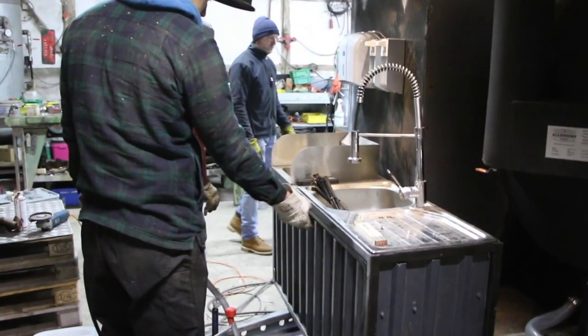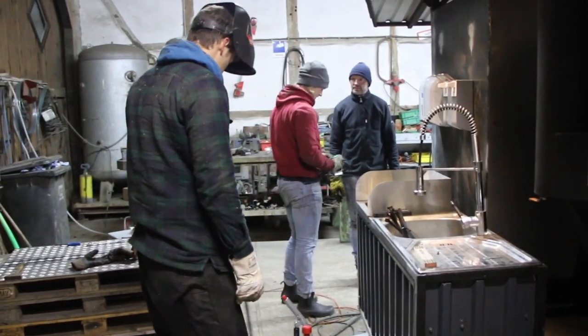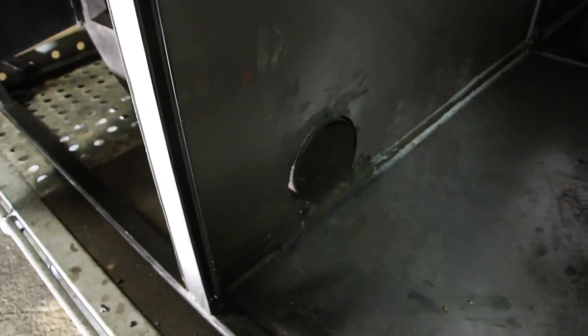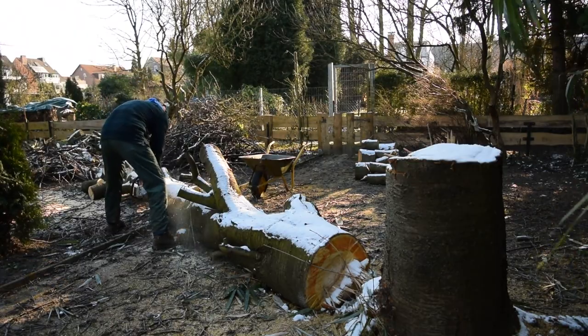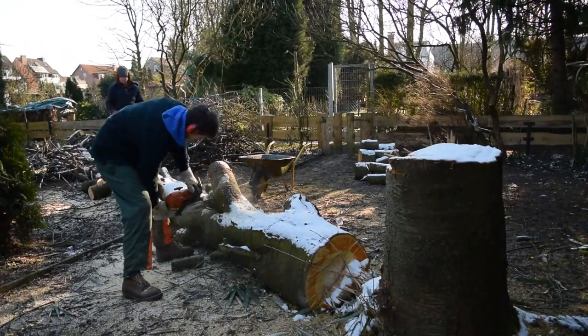Taking one final look around the rig at the progress made by the end of 2018: the water unit is pretty much done, just needing a lock on the door and some final touches. The cooktop surface on the firebox is all welded up, not yet painted. And there's an air intake I put in that is later going to funnel air into the firebox so we can keep the door shut if we need to, with a fan on the inside to push air in. So this is it for all the progress we made in 2018.